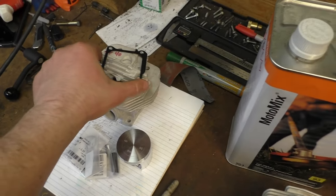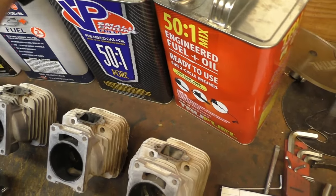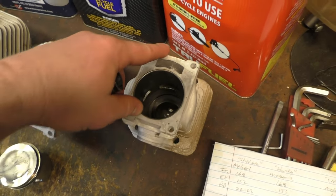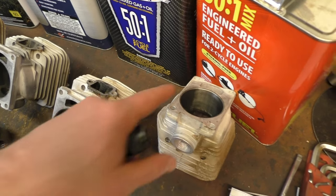Well, next up, we're putting a new cylinder on. It says TF40, so that's True Fuel 40, so that'll be the next video. It'll be comparing this cylinder at 50 to 1, and we'll run 40 to 1, and see what the difference looks like.